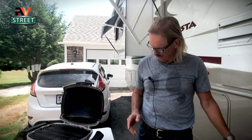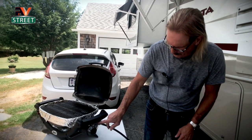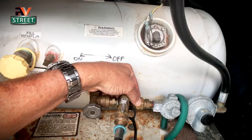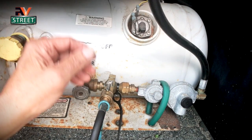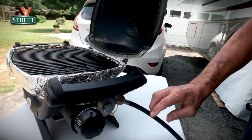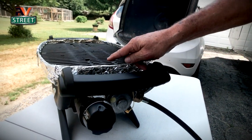When I was investigating this, I did not want to carry all those loose propane bottles. We always have it right here. Now in the event you like the extend-to-stay but you don't have this kind of barbecue grill, your barbecue grill has to have its own regulator. So by putting in the extend-to-stay, I'm bypassing that original regulator. It comes through this hose and up through this regulator, so the pressured propane is regulated going to the grill right here.